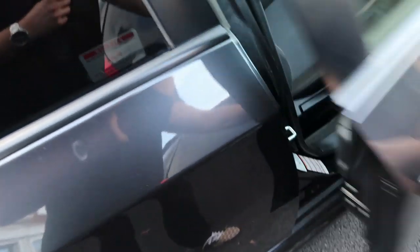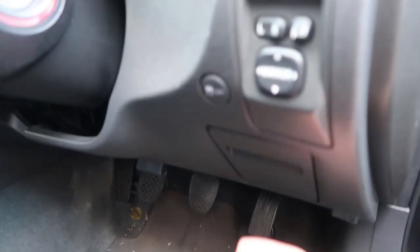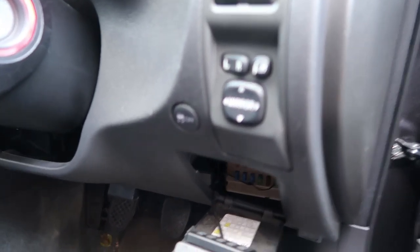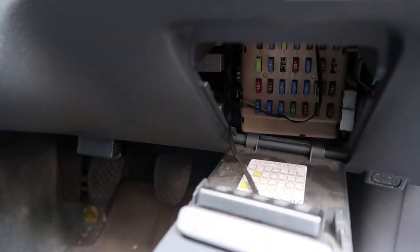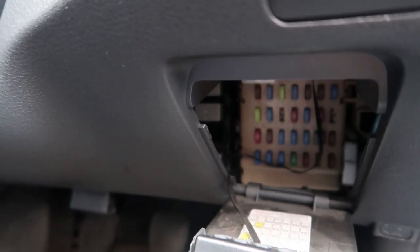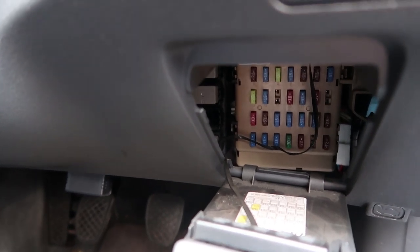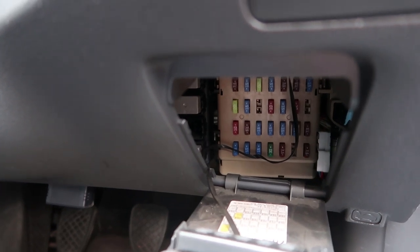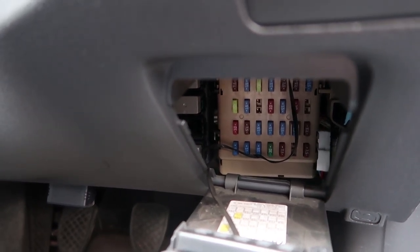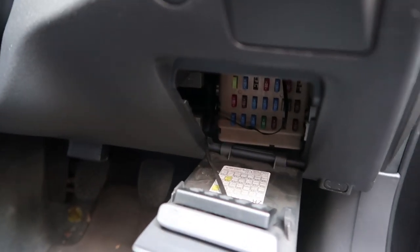We ran out of battery so we're trying this again. I want to run direct power to the dash cam. There's the fuse box on the driver's side with a little diagram. Normally you're trying to find head unit circuits — those go off 10 or 20 amp. I'd rather blow a fuse that's too low than put a bigger fuse in and cook the device.